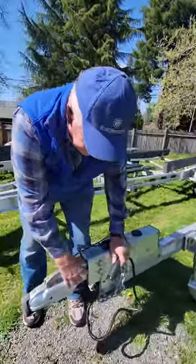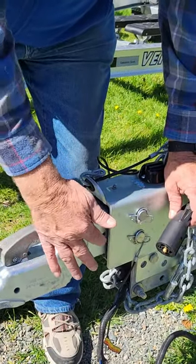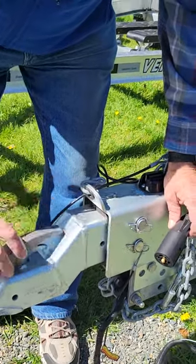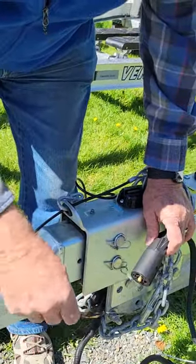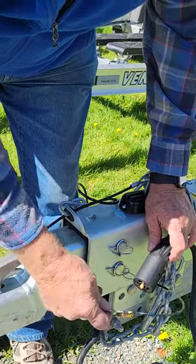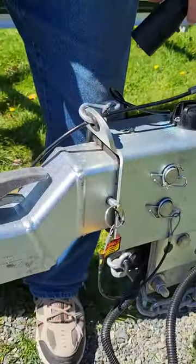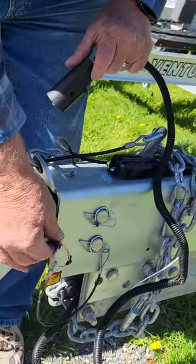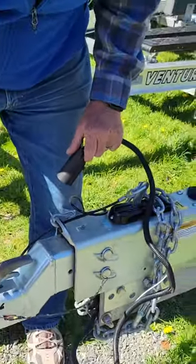This hole here will not be visible when you've backed up. When you pull forward, this will come out of here and this hole will be visible again. You can take this pin that normally rides in this hole and stick it in this hole. That will disable the brakes so that you can back up. It's a loose fit because if you forget, it will hopefully fall out and you'll get your brakes back.